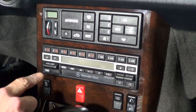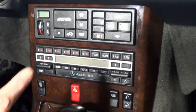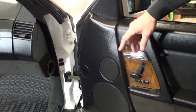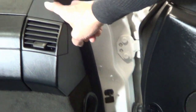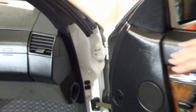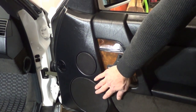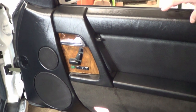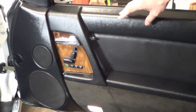It's what's called a head unit — it has no amplifiers; the amplifiers are elsewhere. This car has six speakers, three on each side. There's a high-frequency speaker located here which is very easy to remove and replace, and behind the door panel you've got the mid-range and the bass. I'll show a quick clip of how they look behind the door panel with it removed. I have a video on how to remove the door panel on my HandyVal channel if interested.